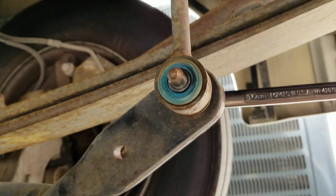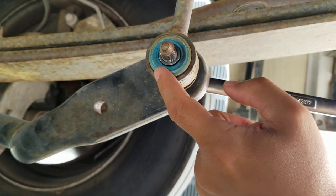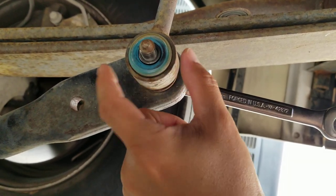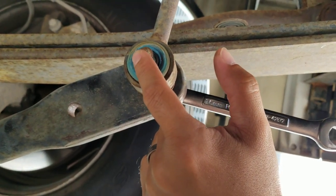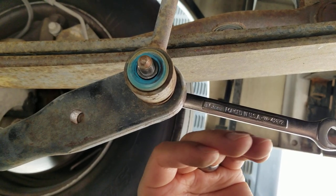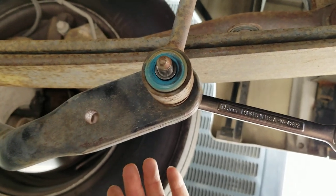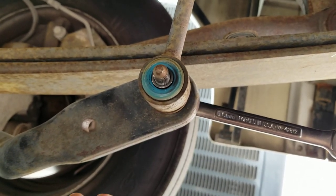This video shows what to do with the Cheap Handling Fix for the Ford F53 frame Class A motorhome. The majority are on the Ford V10 6.8-liter, which uses the same frame. Once I remove the bolt, I'll try to get a clip of it at the new setting. The torque on the bolt is 66 foot-pounds. Thanks for watching — any recommendations to make the video better are always welcome. Hope this helps, and this has been another episode of 'Now You Know.'